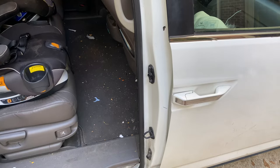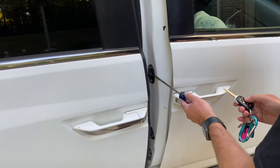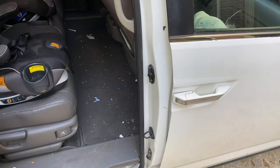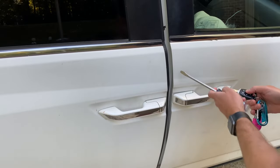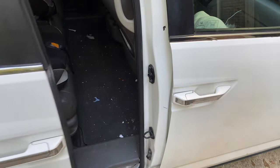There are a couple of different ways you can do this. First, like I mentioned, you can have the door shutting and let it show you exactly where the sensors need to be. Or you could just let it shut, guesstimate where the door closes, and then adjust the sensors after the door is shut. You can try both methods.